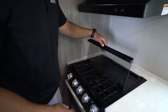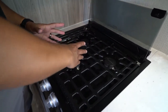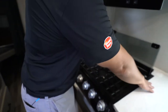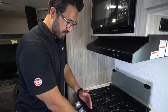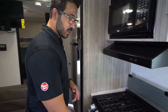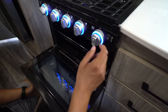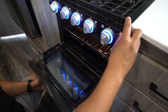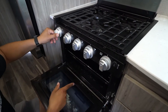With cooktops, make sure your pan isn't overlapping multiple burners. I've seen people try to cover a couple of burners at once — don't do that. The flames will start shooting out the sides and can start heating and burning your countertops. Similarly, if a pan is hanging too far off the front, the flame can wrap around and start melting your knobs. This is more common on a two-burner cooktop but keep it in mind regardless. For the light switch, the single position lights up your knobs only; flipping it down lights up both the knobs and the oven light.